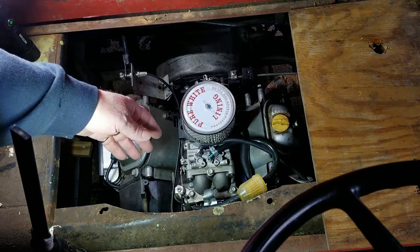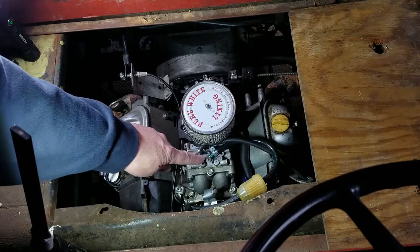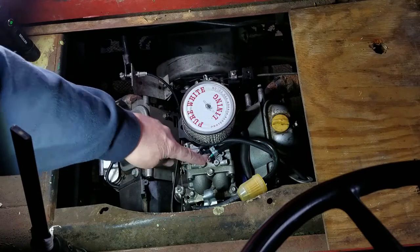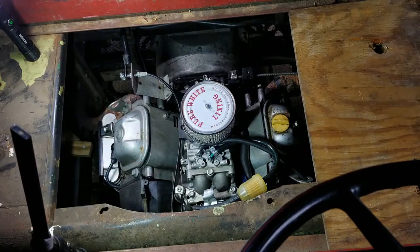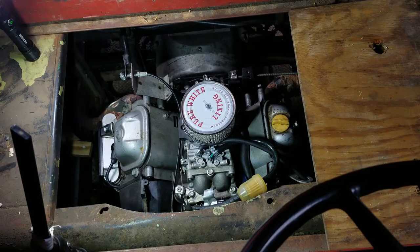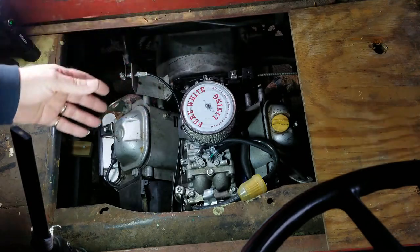The other thing is I changed this carburetor — as you notice, the fuel comes in on the same side as the venting side, whereas normally on the 22 horse carb it comes in from the other side. This is a clone — GX670, a whole bunch of different engines — a 24 horsepower carb. I bought that because I couldn't get the stock one to run, but I did that prior to understanding the jets.